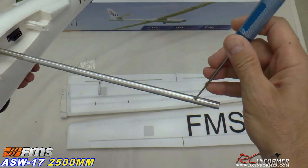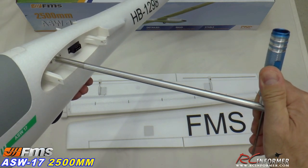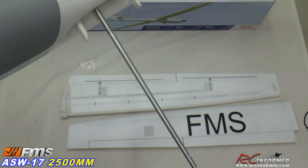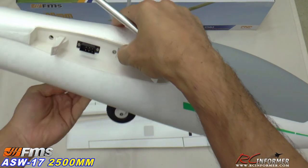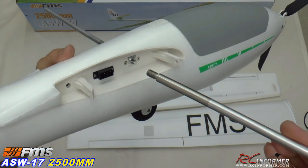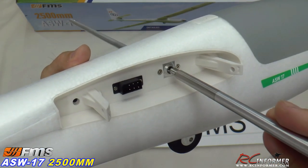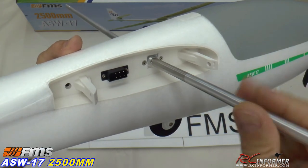And to really tighten it down just a little more, if you put something through that hole and then tighten it a little bit, that'll make sure that it's really locked down. And you shouldn't need any thread lock for this, because you've got a steel set of threads going into an aluminum hole, so aluminum thread. You can feel it as you put it in, it bites. It's a very precision fit.